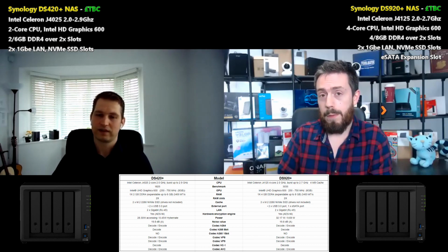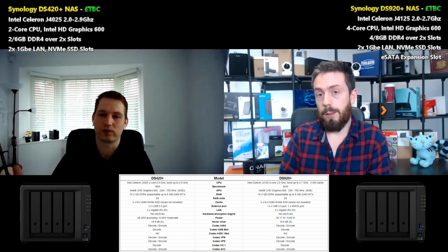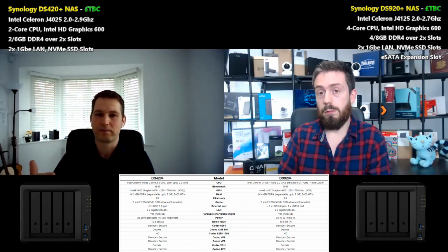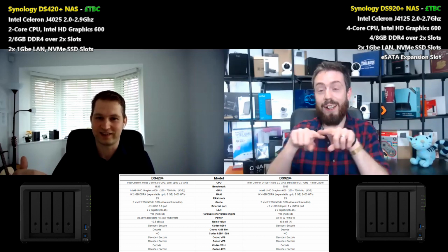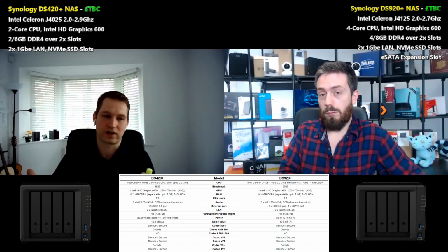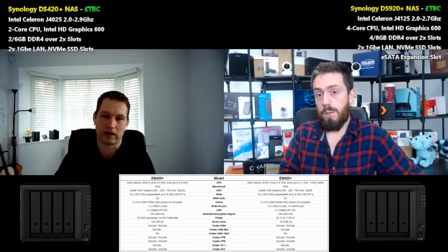Sorry, you were saying. Yeah, but that's why Synology is rolling out models beyond the single gigabit port. You saw the 418 Play used to have 1, and the 420 Plus has 2 ports, like any other NAS. Even the 220 Plus has 2 ports now, because they realized the day has come that the internet has become faster than your local Ethernet. Yeah, and that's why they added another LAN port, which fights off this argument, because now you have 2 gigabit, either link aggregated or load balancing.